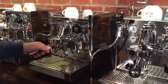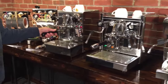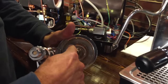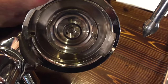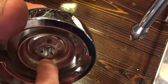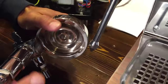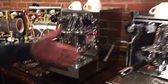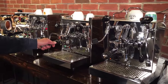The Expobar is a little different from the others. What they've done is hollowed out an area in the E61 that acts as a pre-infusion chamber. When you raise the lever up to brew, water comes out of the center, hits the shower screen, backs up and fills this chamber, and then the water slowly starts to pressurize on top of the coffee. When we brew you'll see that actually in action — we're going to brew and steam on all these toward the end of the video.